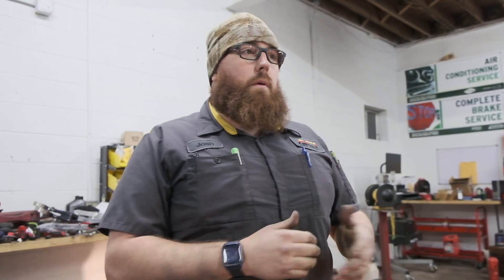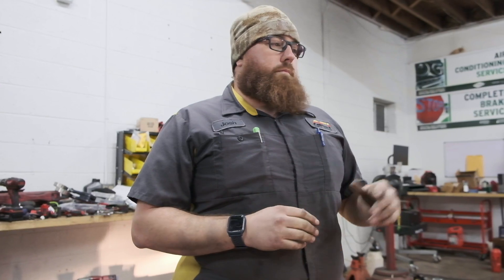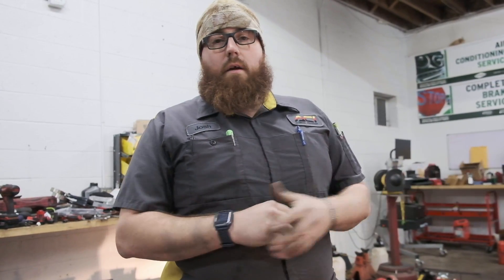This is about a level two out of a five job. It's not terrible. The removal is a little easier — you have to pull the intake off, though you can leave it on, pull the boost hose, pull the throttle body. It's not as bad. You'll see from how we've done this one — it wasn't too terrible. Puddles took care of this one for us. He got in there.